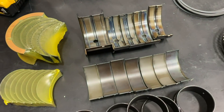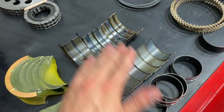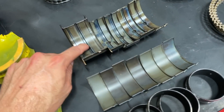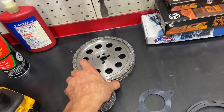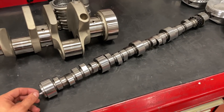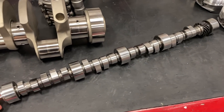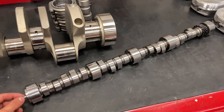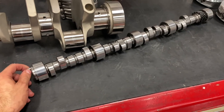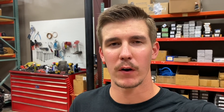We're running coated tri-metal race bearings on the mains and the rods, using a half-groove design so only one side has the groove to help keep windage down. Here is our timing set, upgraded to a roller bearing to help cut down on friction. This is the brain of Zach's 572: a Comp Cams billet steel hydraulic roller cam with 255 degrees of intake duration, 267 degrees of exhaust duration, on a 109 lobe separation angle. Lift comes in at 0.632 inches on both intake and exhaust — it's just going to be absolutely wicked. Before I start building the engine I'm going to completely clean the cylinder bores and every bearing surface on the block, install the cam bearings, set the ring gap, check bearing clearance, and once everything is perfect we can start assembling.